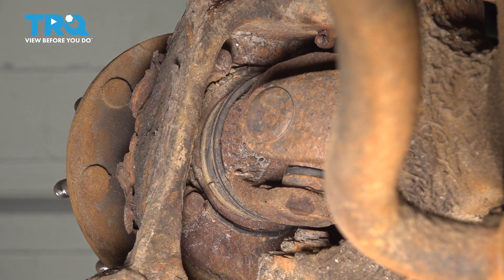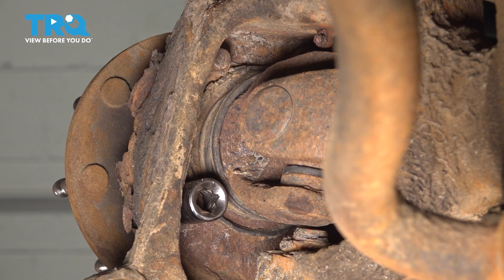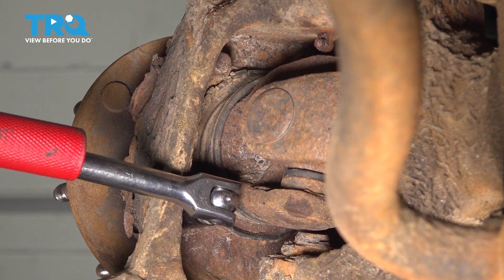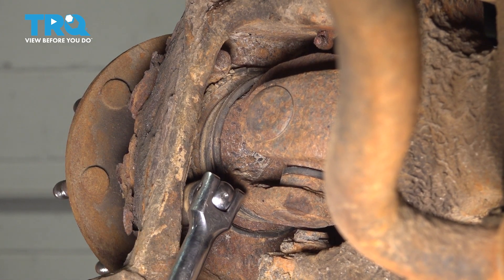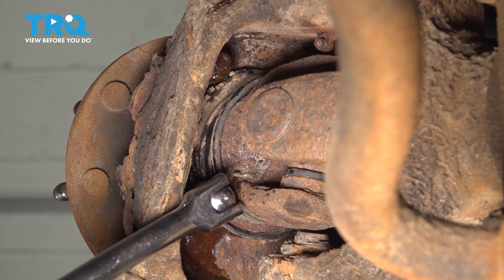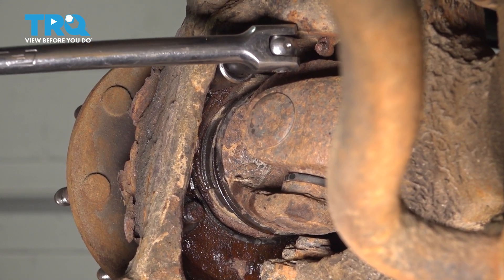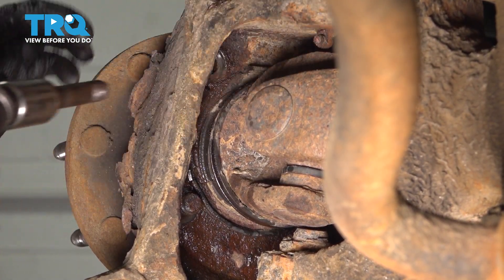On the back side, you'll see four mounting nuts that hold the wheel bearing onto the knuckle with some studs. We'll have to remove the mounting nuts and then we can take the bearing out. These are supposed to be 21mm mounting nuts — I'm hammering a 20mm on because mine are pretty rusted in there. Try to break these free. These are very tight and you do need quite a bit of leverage. I'm going to spray some rust penetrant in here to try to get it worked into the threads. One of them pulled the whole stud out — that's okay.